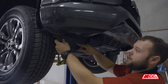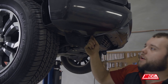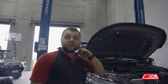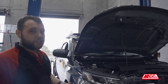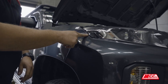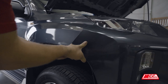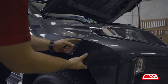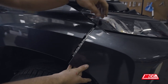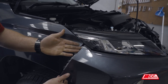Just to make it easier getting the bumper off, make sure everything is unlocated. Push them back to make sure they're nice and free so they don't hang up or get caught on the bumper when you're pulling it off. A few things to be aware of — mainly scratching hazards. Make sure you don't let the two surfaces rub against each other and don't scratch the bumper on the headlight. Start from down here, pop it out, and as you're popping it out just wiggle it. Don't put too much pressure on it because there are clips you need to unclip without breaking them. As you pop it out, just let it rest there — make sure it's not touching the headlight and is only resting on the inner side surface.